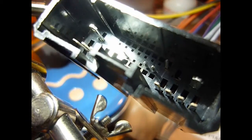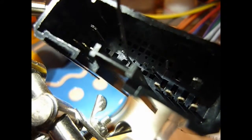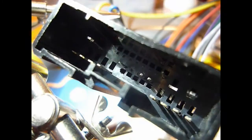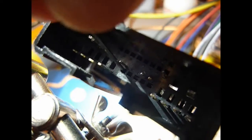What we need to do is put a needle into the hole directly above it and kind of angle it downwards to remove the pin from the head. So again, into the hole above this pin, put your needle in and push upwards or downwards to push on it and pull the wire backwards away from the harness. I'll show you right now.